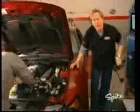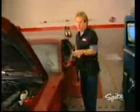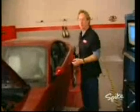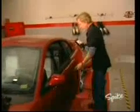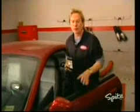Hey, good job. By the way, you won't be able to reuse that factory shroud with the idler, so when you're under the hood, you have to be careful not to get any fingers or loose clothing caught up in the belt. But now, it's time to reprogram the computer once again to optimize our fuel and spark for that added boost.